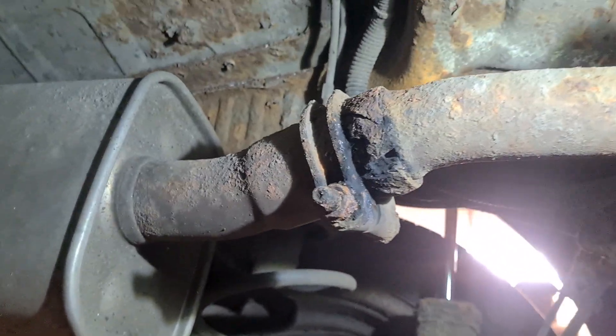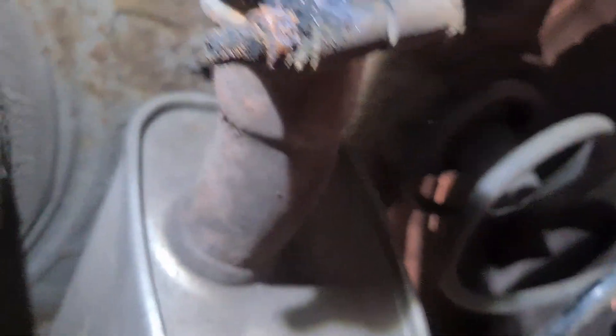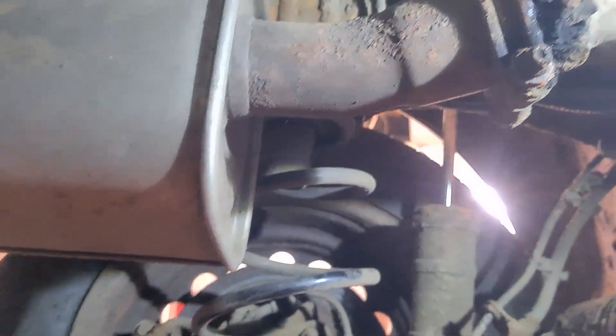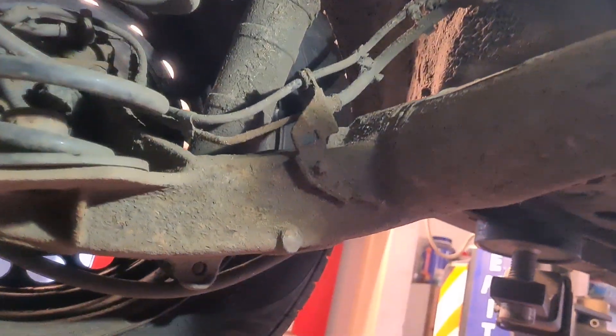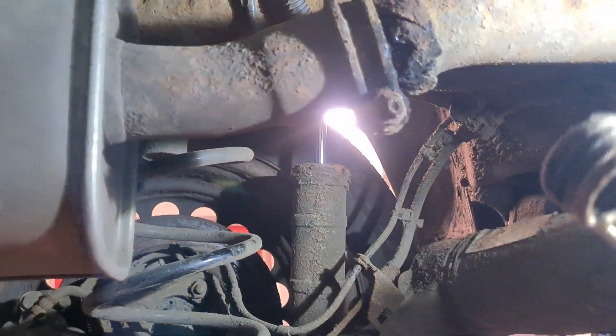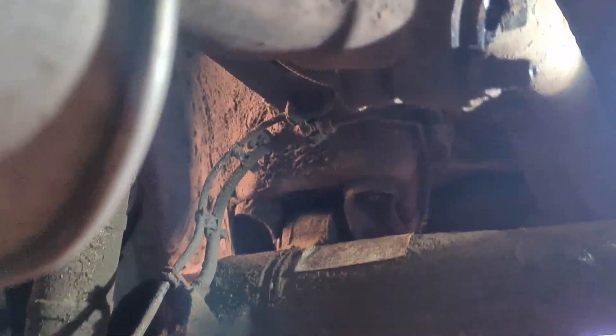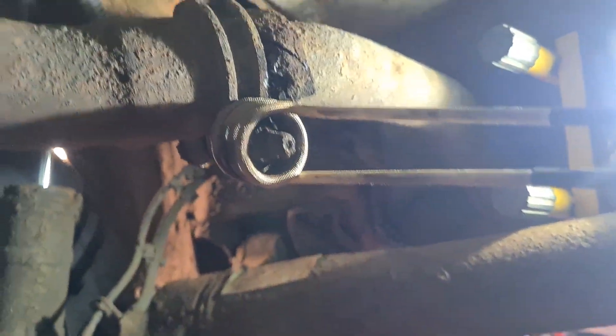I've got the lamp on so you can see that is a very nasty-looking exhaust clamp bolt. What I like to do is warm it up, get my wire brush, wire brush off the loose rust, then warm it up again so it's all glowing red and then wind them off. With this tool it takes seconds and it's super safe. This one is stone cold — you can see I'm putting my hands on it. I'll throw the tool on and press the button.